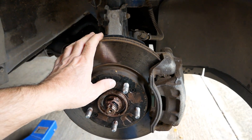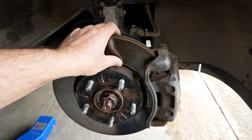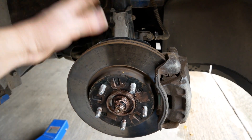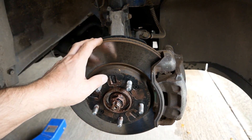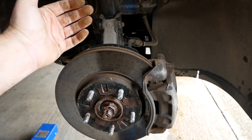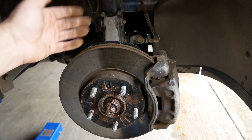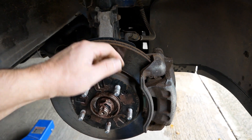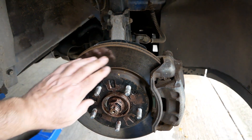If you're at all concerned about noisy brakes, just use your brakes more to give the car a chance to clean up the discs. A good way to do it is to get up to speed — around 50 to 60 miles an hour — make sure no one's behind you, and brake hard, going from about 60 down to 10 or 20 miles an hour very quickly. Repeat that a few times. That puts some pressure on the pads and gives them a good cleanup, generally clearing any rust or muck on the discs.